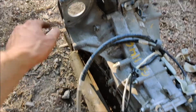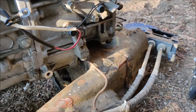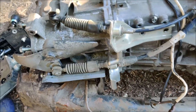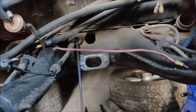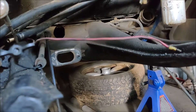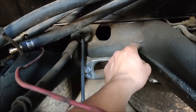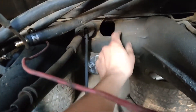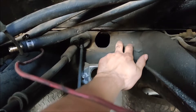If I try to put it right there at that position it's going to be pretty tight. I knew from the get go that I was probably going to have to cut out the torsion tube. So we'll go look at the back of the blue car and that'll give us a better understanding of where we're going to end up. The goal is going to be center of gravity as low as possible and as far back as possible. The main obstacles are the torsion tube housing, the edges of the frame horns, and this little guy.